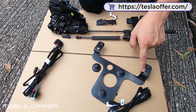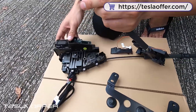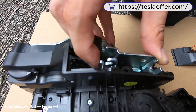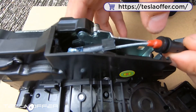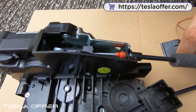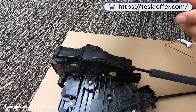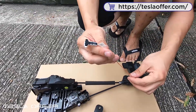For the rear door, let's try to attach the latch motor to the lock first. To attach it, I just use my finger to pull this out, then attach the latch motor here. After that I put it here, secure it, and then install this cover back in here. This orange wire doesn't have any use — you can cut it or just leave it.